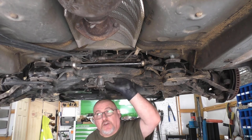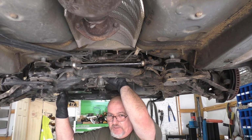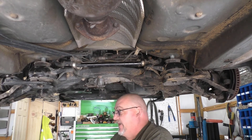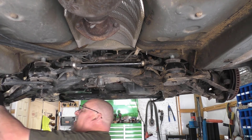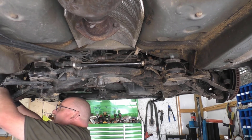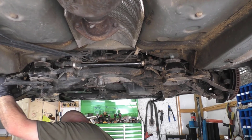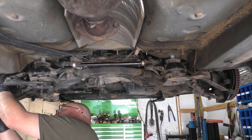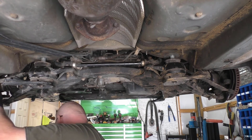All these fasteners around the underside of the vehicle, of course, something to consider if you are in the upper states. Put some anti-seize on that. Get accustomed to using anti-seize when you live up there in the Rust Belt area. Always makes it easier to get the crap back off later on. So. We'll go ahead and stick the castle nut back on there. I got to drill it out of the other side. We have to rip it off.